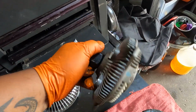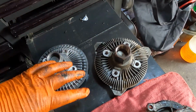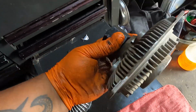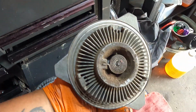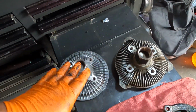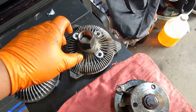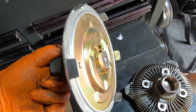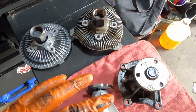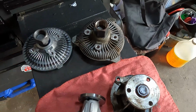When it's getting old and I turn on the AC, the cooling fan blade is not actually rotating fast. There's a special fluid inside that gets worn out. Once the fluid inside is not working properly, it's not going to turn the cooling fan blade as much as it's supposed to. So I have to replace that one, and I'm going to put all the part numbers in the description once I'm done editing the video.